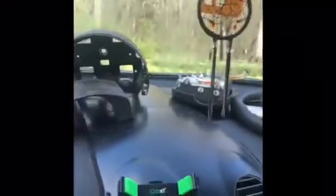The steering wheel taken off, and the odometer taken out. But when I got in here and pulled this off of the back side, so if you look here on the back there's the rear side of the ignition switch. Of course, there's the front side of the ignition switch. So when I pulled the connector off the back side of the ignition switch, if you look right in this area, all that's melted. I've already taken out the burned terminal. That terminal's right here. Here's the terminal. There it is. It's all burned up.